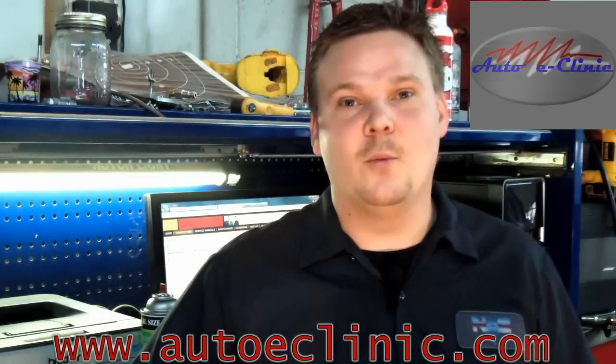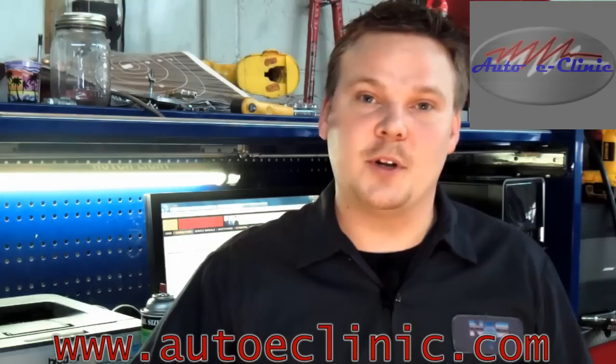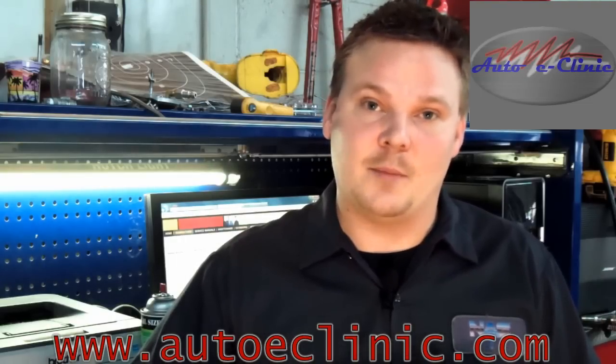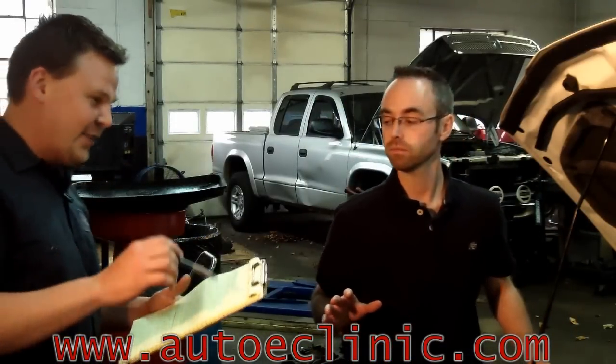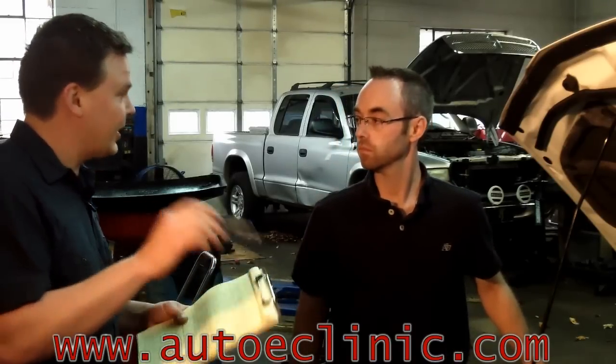Now that we have our code, we want to check our code against technical service bulletins. Technical service bulletins are put up by every manufacturer. They are known fixes to common problems. After the visual inspection, everything looked to be in proper working order and intact. I just found a TSB referring to the purge valve, talking about it leaking down and causing our code.